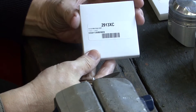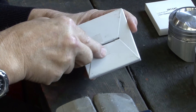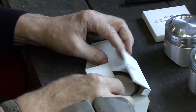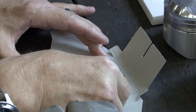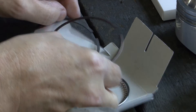Firstly you need to carefully open up the ring packet and separate out the different rings. On most four stroke bikes there will be two thicker compression rings. The oil control ring on this bike is made up of two very thin rings and a wiggly spacer ring. Sometimes the oil control ring will be made in one very fragile piece.